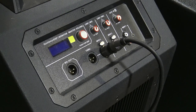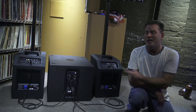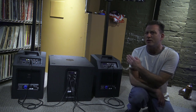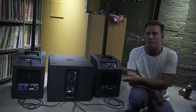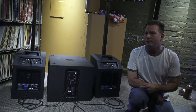The Evolve 50s are running full range all the time. What I was thinking was, if the subwoofer had the high-pass filter output option, we could kind of turn these little subs on the Evolve 50s into really mean mid-bass machines. But you can't do that with this particular setup. If you had a sub with that high-pass filter output, you could — but not with this one.